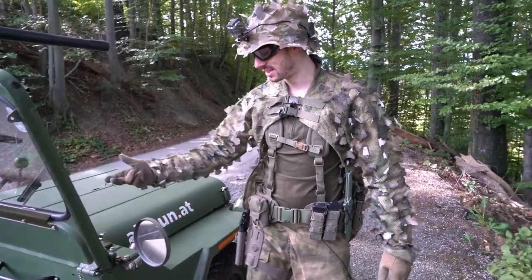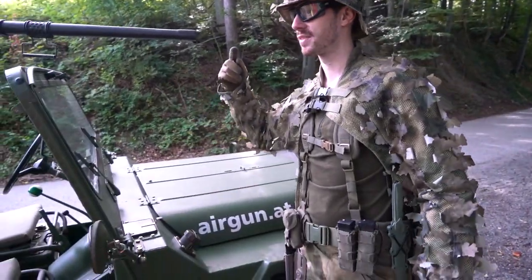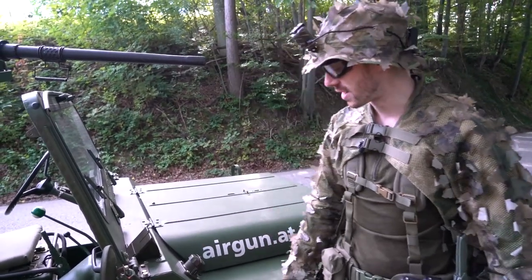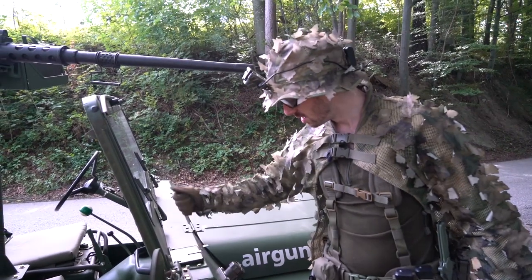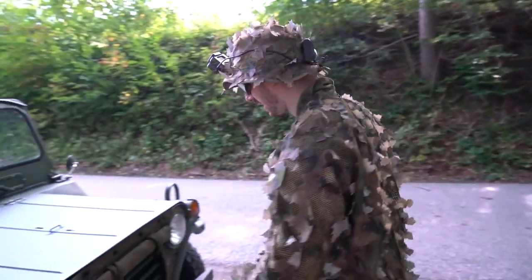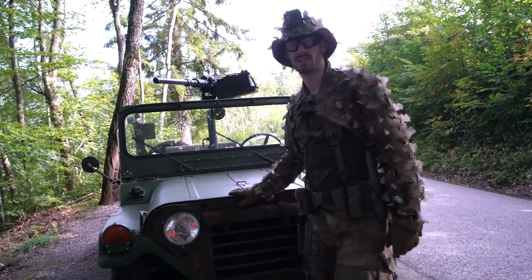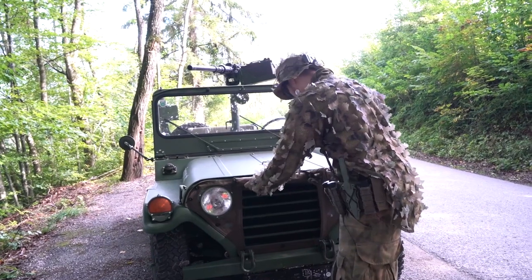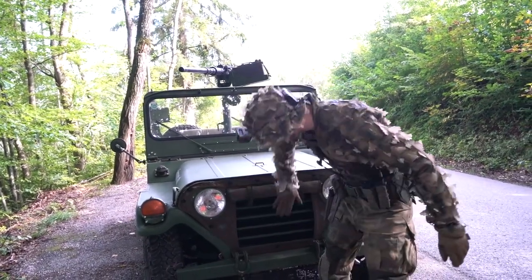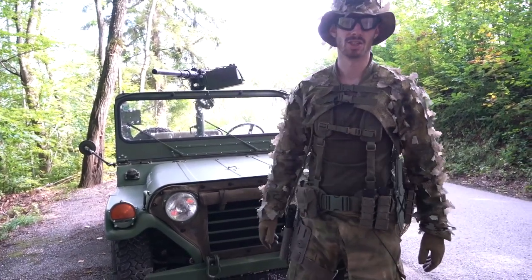There's a little flap here where you can switch between internal ventilation and fresh air intake, so when you heat the car you can still get fresh air in. Then up front we have the cover for winter — when the vehicle was standing still in cold temperatures and they didn't want the engine to cool down too much, they could open this and bring it down to block the grille and keep the cold out of the engine.